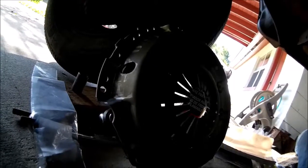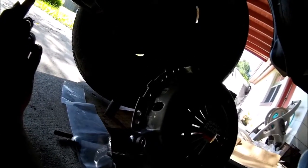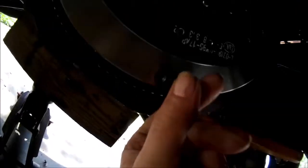Okay, and there's your pressure plate that goes over it. These little spring fingers go out. If you turn this around the backside, I can't do it because it's too discombobulated, uncoordinated under here, and I don't have the room or the strength. But there's a shiny plate that almost looks just like this ring on the flywheel. It'll go on there. And there's holes on the outside. And those holes are going to match up with your locating pins on the flywheel. There's 3 of them. So let's try putting that in.